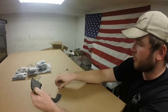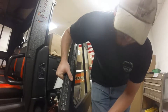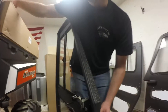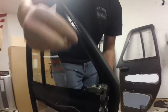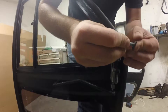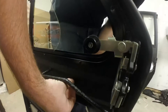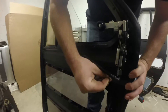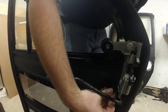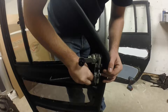Now we can take our other three bolts, which also come with flat washers. We'll put our punch button through the big hole, come in with a flat washer and one of the other mid-size bolts — these are 10 millimeter. Push those through and get them started, then the other 10 millimeter, and take our last one and get it in there.